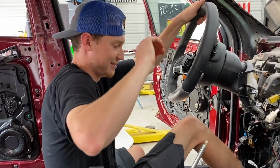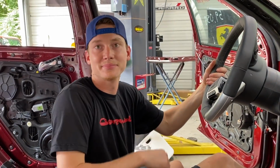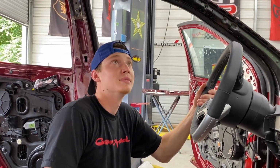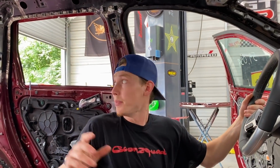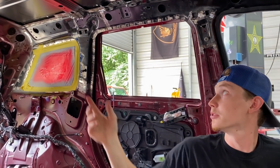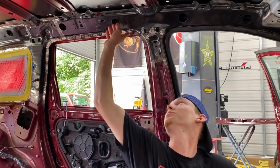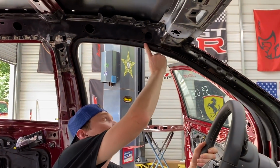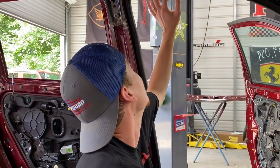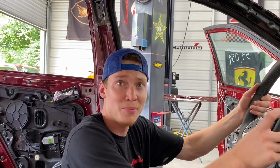Good. So we really don't know if that module is 100% fixed, but like you said, we'll find out once we put the display on and all that good stuff. The next thing we're going to do is hop onto the back first, see if we can scuff that down a little bit and spray some primer throughout all this stuff, because as you can tell, there are some spot welds all over here where this molding is at. We'll scuff it real quick, make sure everything's nicely prepped, then pull this off, maybe do a little taping, and spray some primer and then some red paint as well. We've got that rattle can paint, so we'll spray this in and it'll look almost OEM after that.